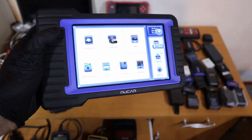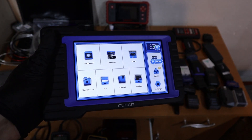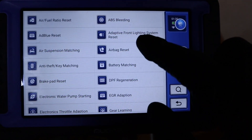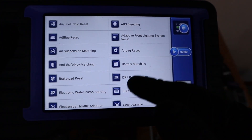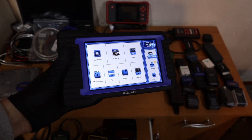And it is not even that expensive — it was like 320€, and I can connect to any control module, read data in all modules, do service procedures like airbag reset, battery matching, DPF regeneration, or even ECU coding to unlock hidden features.